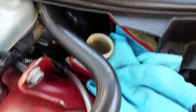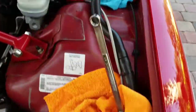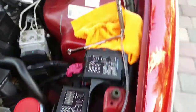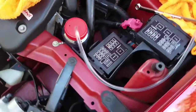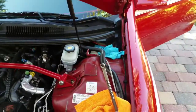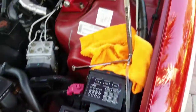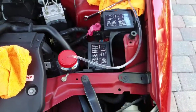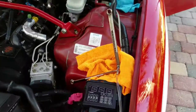I'm going to repeat this a couple more times, but that's pretty much how you bleed the clutch if you've got one of these quick bleeders installed in your vehicle. Otherwise, if you don't have one, it's going to be a nightmare. This is the first time I've done it this way — I usually use a handheld brake bleeder, but it's such a pain to set up. This is much quicker and easier. I think I'm going to stick with this method.